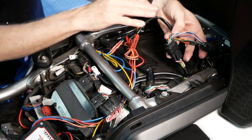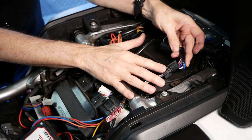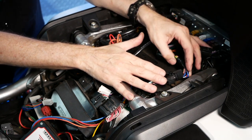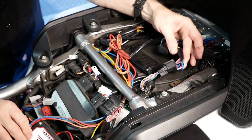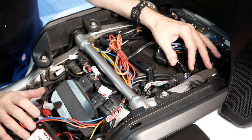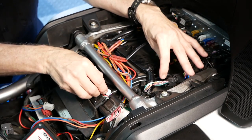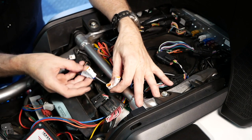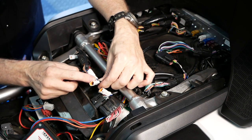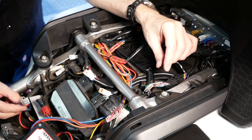I had to basically unhook my trailer when I connected my Pathfinder LED brake tail light and I haven't been able to use my trailer since. So how can we get rid of some of this wiring? What I'm planning to do is eliminate the Pathfinder LED harness and wire my brake tail light and any Pathfinder LED accessories directly into this isolator fuse block. I don't really need that harness since I have the isolator fuse block.